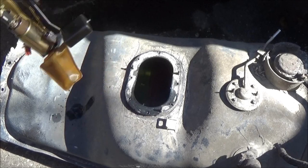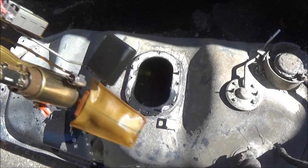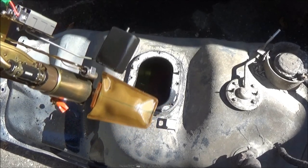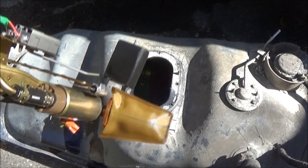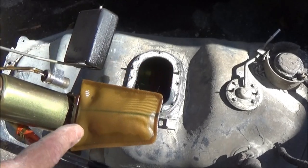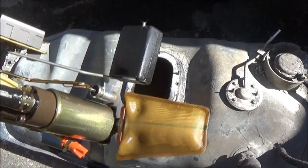When you're on full, that floats up — that's your full mark. So if you bend that you might get a false reading either way. If you get a false reading, it could read like you've got a half a tank of gas when you don't. I'm going to blow this off real good and get you up here on the tailgate and show you — here's the pump and this is your sock, they also call it a strainer — and I'll show you how to change this pump out.